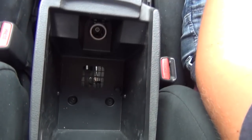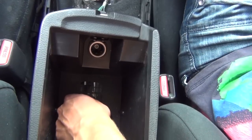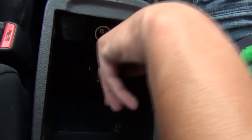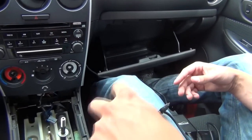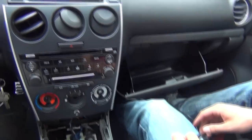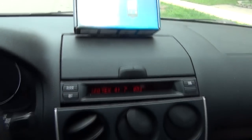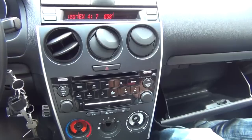With everything off, once you remove the carpet from your armrest, you'll see there are already holes there. You can knock them out a little bit to feed the cable through. It's very easy to run it through the middle right now. You can also run it to the glove box — it's up to you, you have a lot of options in this car. After you run the cable, put everything back and start enjoying your GTA car kit in your 2006 Mazda 6. We hope you liked the video — it's very easy to do on this car and anybody can do it. We'll see you next time.